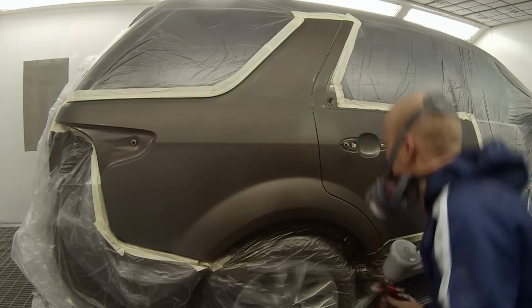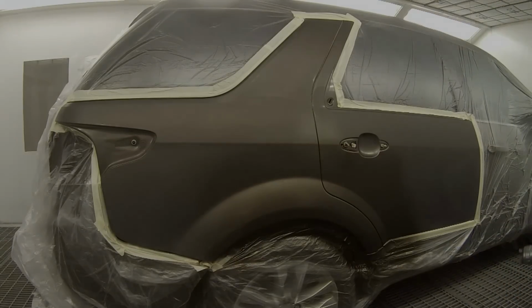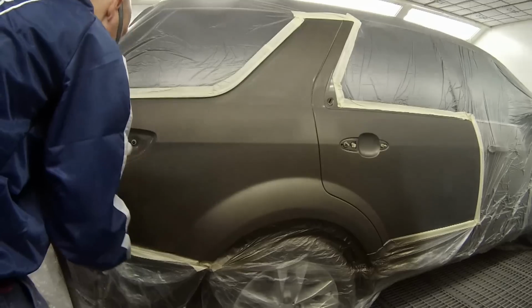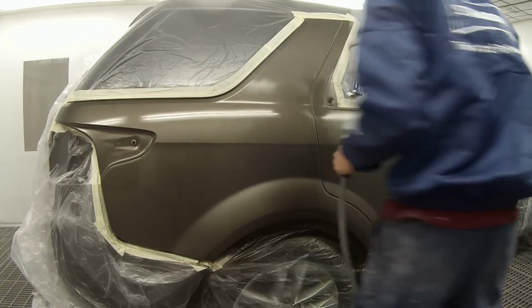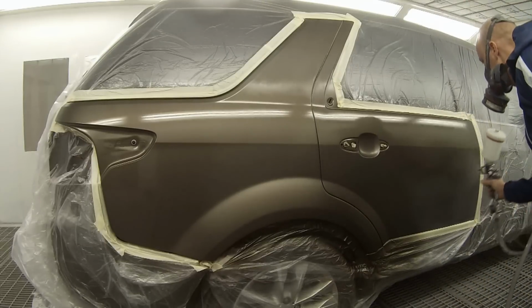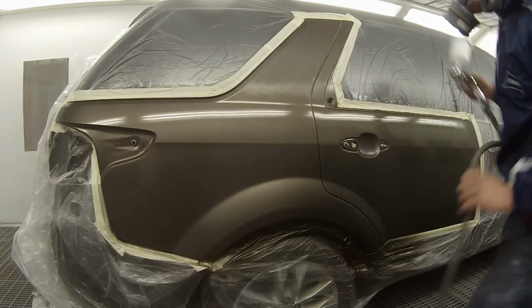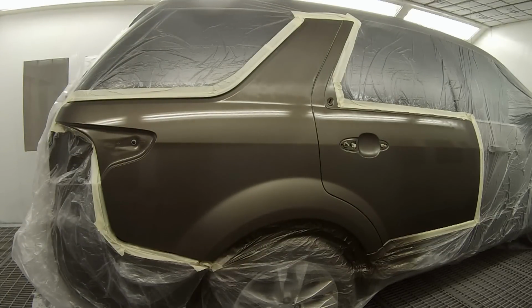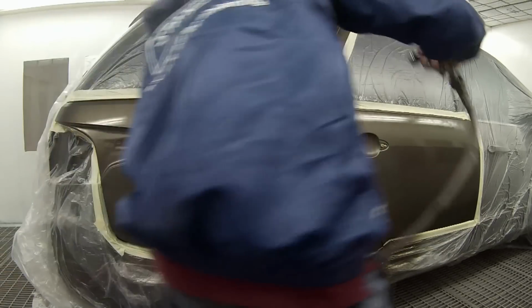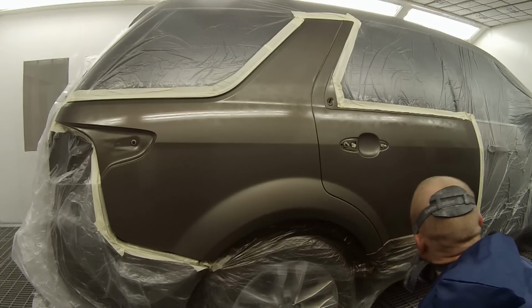After you've got your second coat on, I will then grab my blending clear, which is just your clear base coat, which aids the blend. So just put that over where the blended area is going to be. That helps the base coat to land in that wet coat of clear base coat, and stops you from seeing any blotchiness when it's cleared.